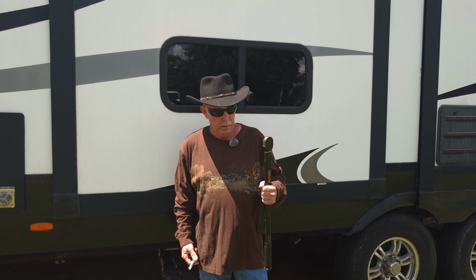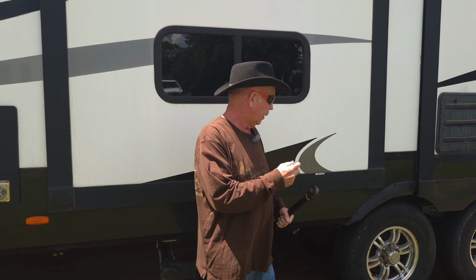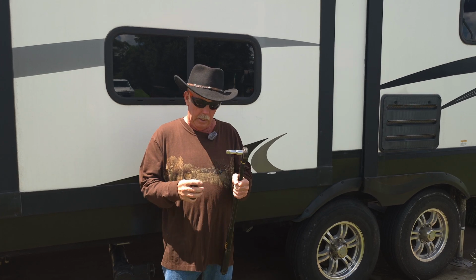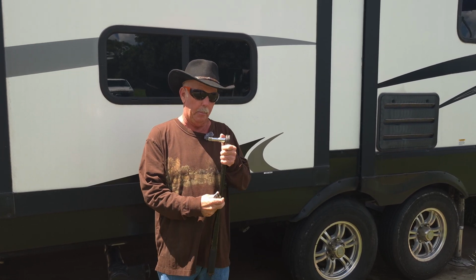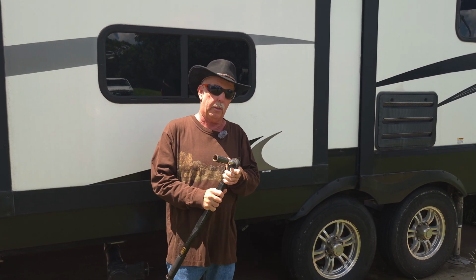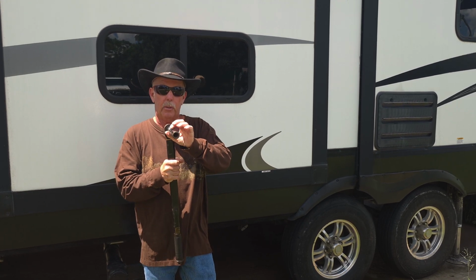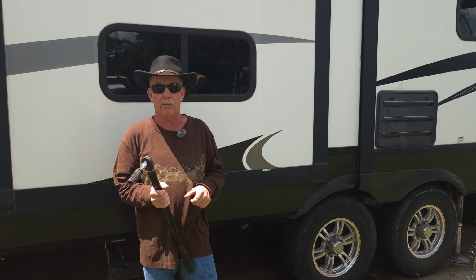All right, so you're going to need your torque wrench here. We're going to add a little extension in there so we can get into those deep lugs. So we put that little 1/2 inch extension on there. And this is a 1/2 inch torque wrench, by the way. And here's your socket. This one requires 19 millimeter, but yours may be different. But the definition of torque is when you're turning this thing around and you're cranking it down, how many foot-pounds are you going to torque it to? And in this owner's manual, like I said, it's 90 to 100.